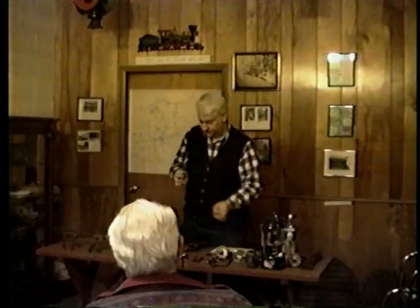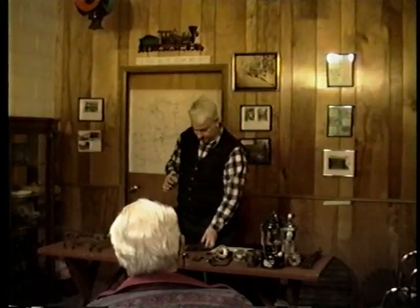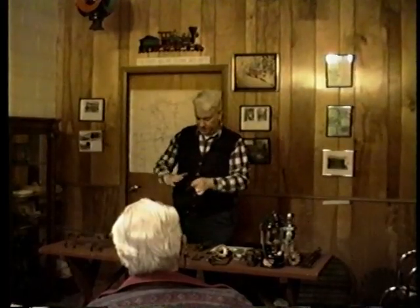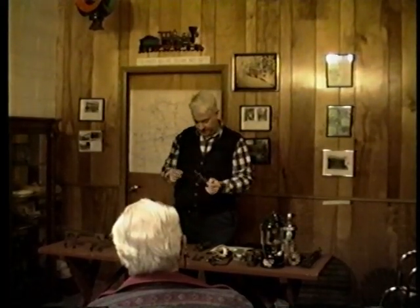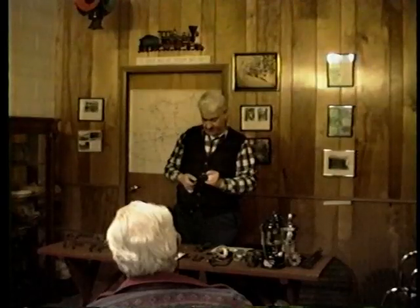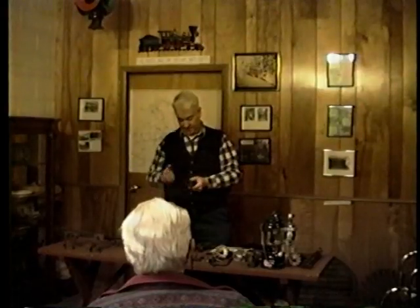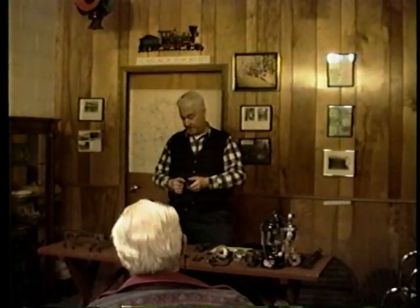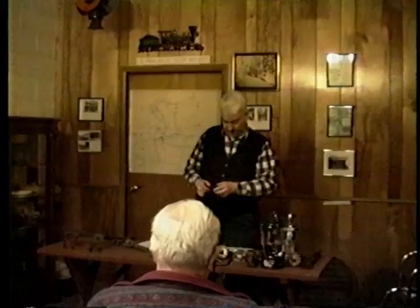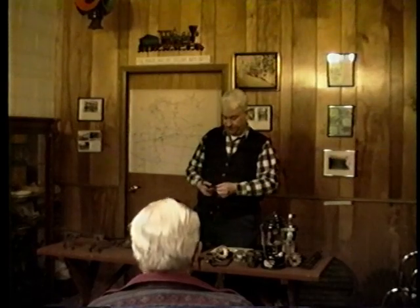See the pin? And the pin got carbon. But the pin also, besides just about obstructing that hole in the nozzle, a file was put to it to file a flat place on it. And when that was put back in there, the flat place was the only place between the outside wall of the nozzle and the flat of the pin that fuel could pass through. And that was enough under this extremely high pressure of 80 pounds or so with the gasoline models. With the kerosene, they were down to between 15 and 35 pounds. It was enough to keep the pilot burning.